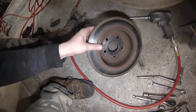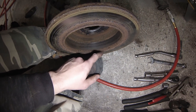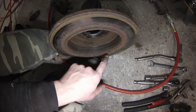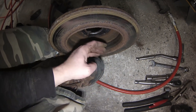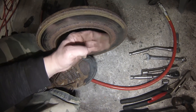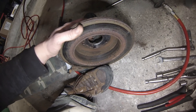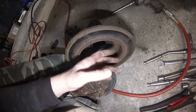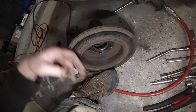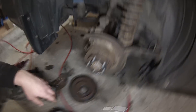If you're ever wondering why your rotor won't come off the rear, it's usually because of this ridge that builds up in here. You can see where the shoe's been sliding around inside, and to get the rotor off it needs to go in that direction, but the shoes get caught on this ridge as you're pulling. Sometimes you can get to the adjuster and adjust down the shoe to collapse them a little bit so the rotor will come off - that goes for most drums.